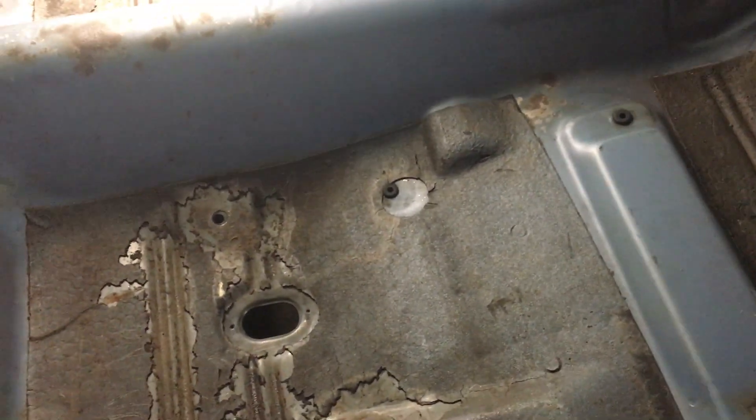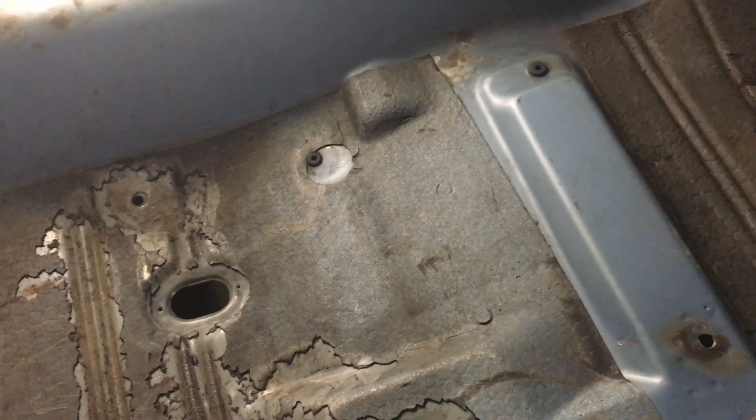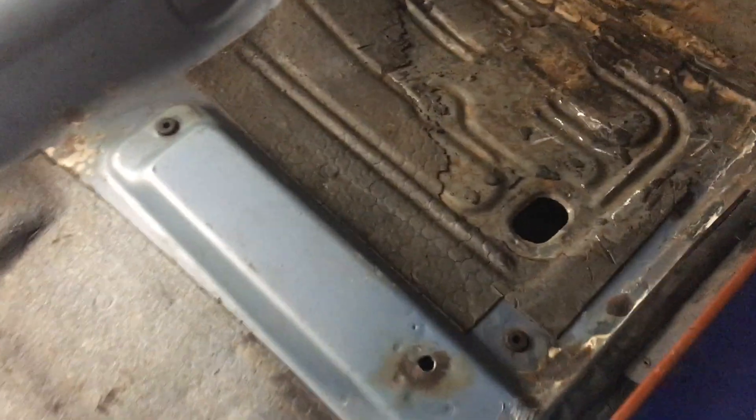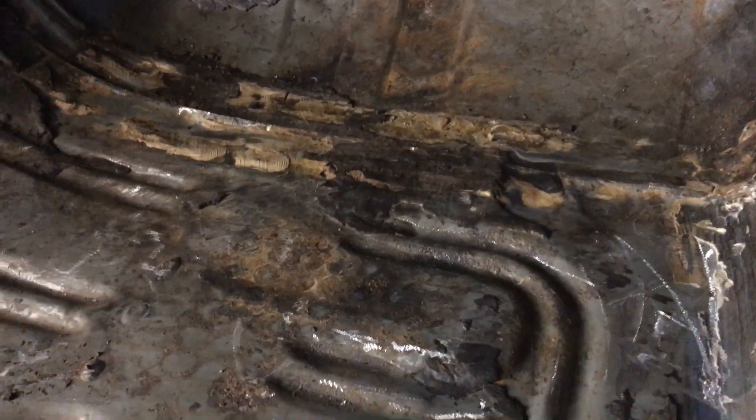The interior came out really easy — no problems with the seats. Sometimes when people pull these out, the bottom seat mounting bolt holes will get those bolts bent just from wear and tear. I knew the plenum chamber was good. There are no holes in the plenum chamber other than where they obviously should be for drainage, which is normally a really good sign. If you've got no holes in there, your footwell is generally pretty good. In my other car she had some holes in the plenum and it needed some footwell repair. When those drain holes work well, they stop that rust in the footwell. I've dug this one fairly well knowing that there's often risk of footwells being wrecked on these things, but this is solid, solid, solid all the way through.